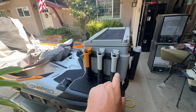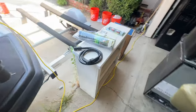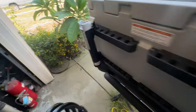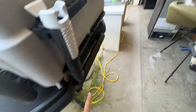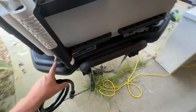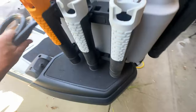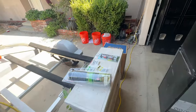Now we're going to work on the wash down and live well hose setup. Here's the original wash down hose that connects from this port back to either of these ports — one will work better than the other on the original setup. This connects here, this connects here, and you can run it either on a timer or in the on position for your live well.